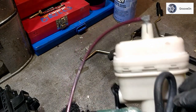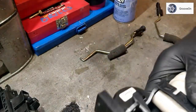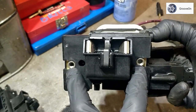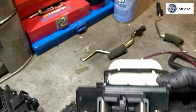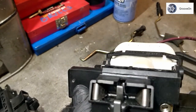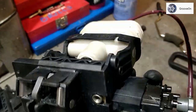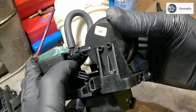When you put the actuator back, make sure the lock is in the same position. It's not difficult — it sits on the car in this position. The two screws will show evidence on the paint from when you undid them, so try to get it back in the same place. The holes on the body are elongated to give a little wiggle room. This is important because the latching system has to work properly — it latches once, then the actuator and soft close pull it in further until it's locked tight, and then pulling the lever opens it again.